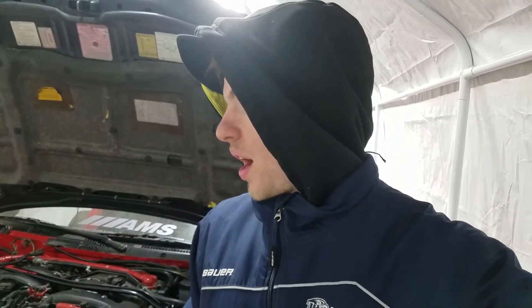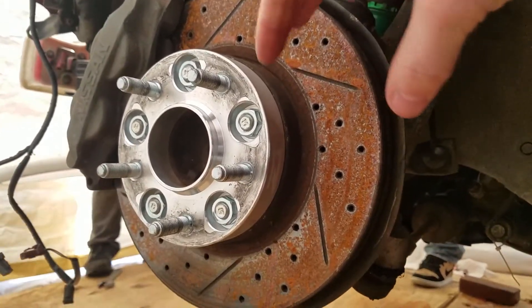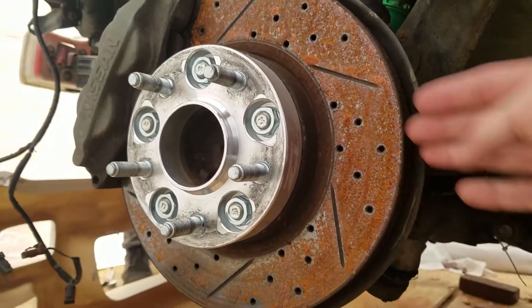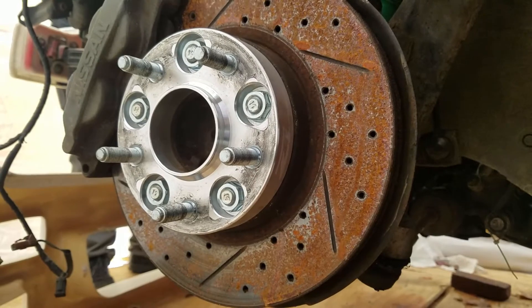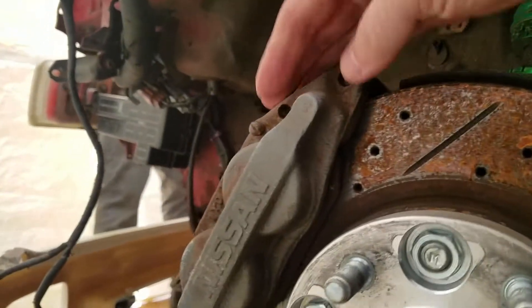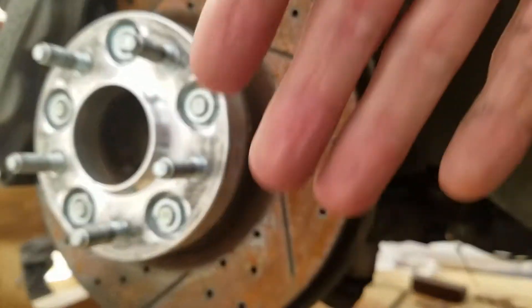So that's what we're going to do today. The first step is you're going to have to raise your car up, get the car on some jack stands, make sure you guys are being safe. Loosen the lug nuts on your wheels and take your wheels off. Since I have my spacer on, to get to the actual knuckle I'm going to have to start taking all this off. So I took off my wheel with the lugs, now I'm taking off the spacer, and then we'll take off the brake caliper and go step by step to get your knuckle off.